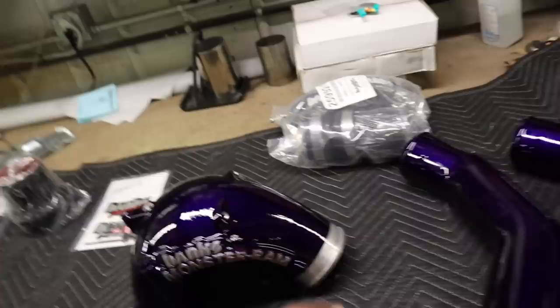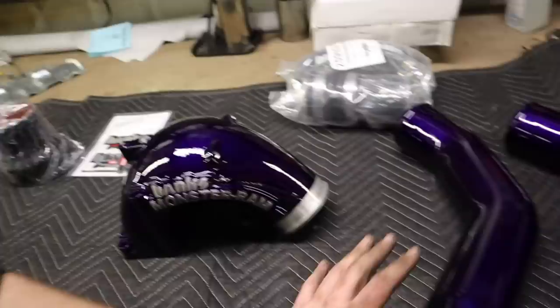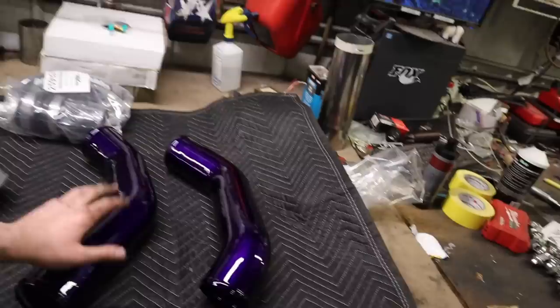When you go four-inch, you can no longer use your stock boost tube. Some people have said they've done it, but even on the website it says you need an aftermarket boost tube upgrade. The boost tube upgrade kits can mount to your factory intercooler, and the upgraded boost tubes can mount to the new four-inch intake horn. So you can use the four-inch intake horn, the upgraded boost tubes, and the factory intercooler for now. I didn't opt for the intercooler yet, but that is 100% in the plans — probably when I do the off-road bumpers.